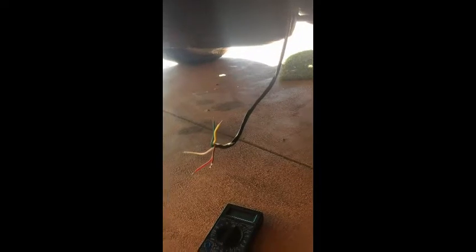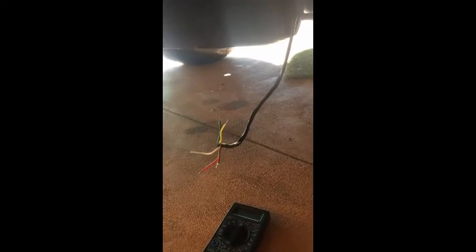Okay we're back. As you can see we've got part of the loom ready to go. I'm just going to slip back under and show you how I went about this — the spare wheel is right there and straight up, there we go, we've got our plugs. Now they plug directly in, they match. Plug for plug, that's stock standard straight out of the factory. I haven't done any adjustments to this loom underneath the car and all three plugs — as you can see there's three whites — all three of them match perfectly.